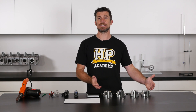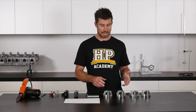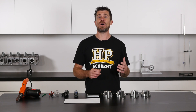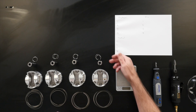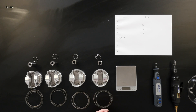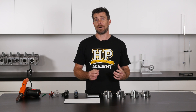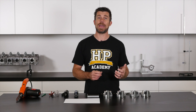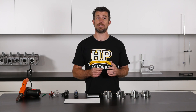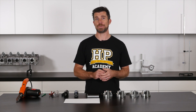I've got laid out the piston assembly for a Subaru FA20 engine. These are JE forged pistons and the entire piston assembly consists of the piston, the wrist pin, the wrist pin locks, and the ring pack. What we'll generally find is that the pin locks as well as the ring packs are normally quite well matched straight out of the box, and the main work we're going to need to do is on the piston assembly and also potentially on the wrist pins.